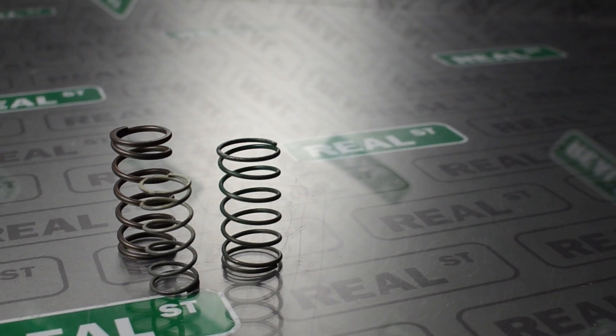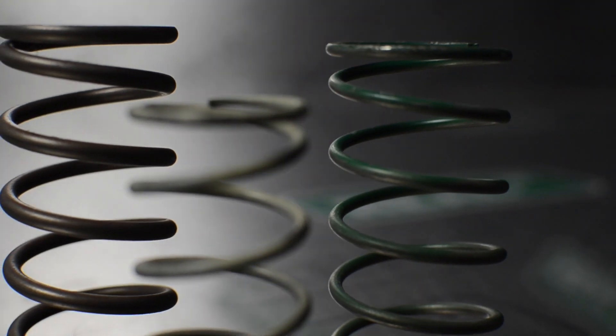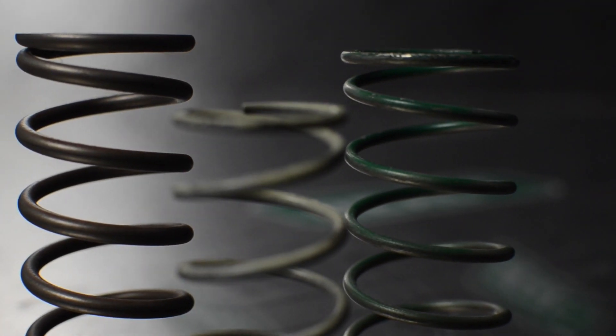You could change the wastegate spring to 10 PSI to fix your low gear problem. However, if you have a 10 PSI first gear, you will not be able to make it to 40 PSI in fourth gear because of the mechanical limitation of the spring.